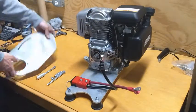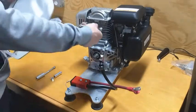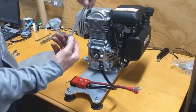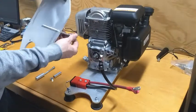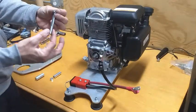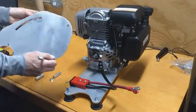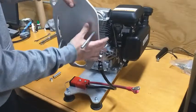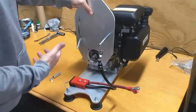We're going to mount the alternator adapter to the engine. Before we do this, we want to stick the fasteners through the backside of it, which mount the alternator. We're going to take the M10 bolt with the lock washer and that's going to go through the pivot bolt. Then we're going to take the M8 fastener with a lock nut and that's going to go through the adjusting plate. Now that we've hung the fasteners on the backside of the adapter, this is going to mount to the engine using the supplied 5/16 fasteners.